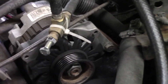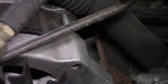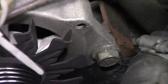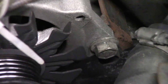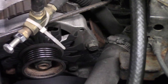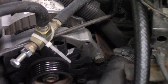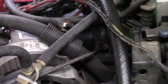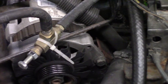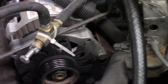This might help some of you guys — here's what I did with my alternator. I just made a little spacer bracket to space it up a bit. Basically there's a nut welded on the back of it, the original bolt goes through the bracket, and another bolt goes through the alternator itself and holds them together. With the previous alternator I had to grind the case down and the valve cover down quite a bit to clear with the 3100 valve cover, so this bracket was just a solution to that.